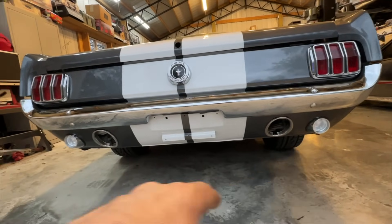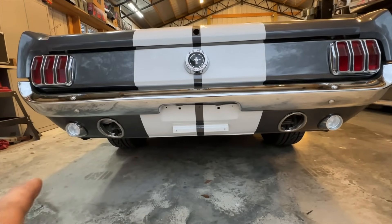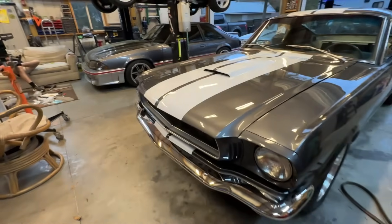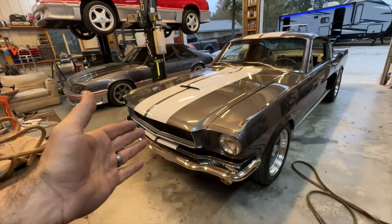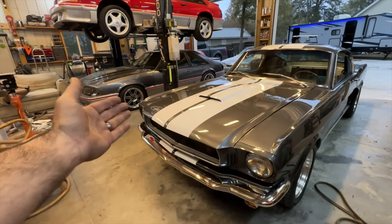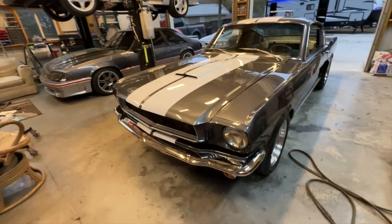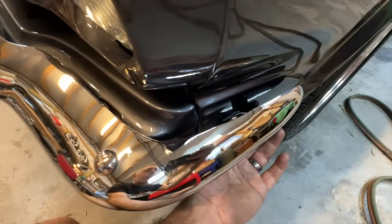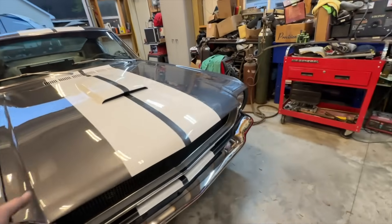In the back, you saw the bumper but didn't see the trim rings - we got those installed last night, along with the reverse lights. The exhaust isn't through yet but we have it ready. The bumper on this car always sat to the passenger side and I couldn't figure out why. Turns out a bracket was hitting the core support, so we bent that around and got the bumper sitting correctly. Everything is in and pretty much locked down.